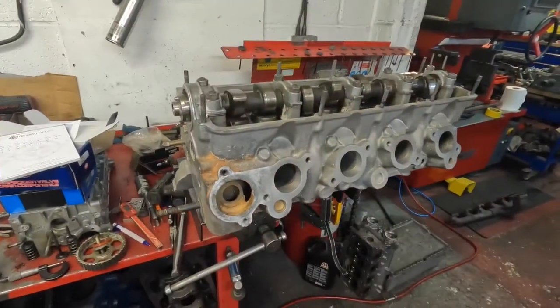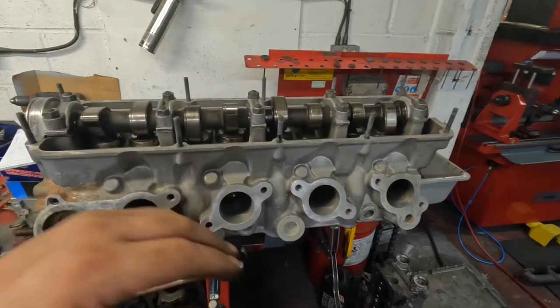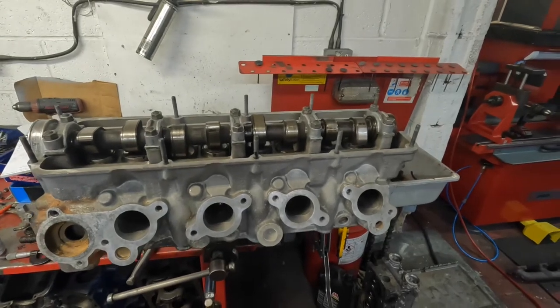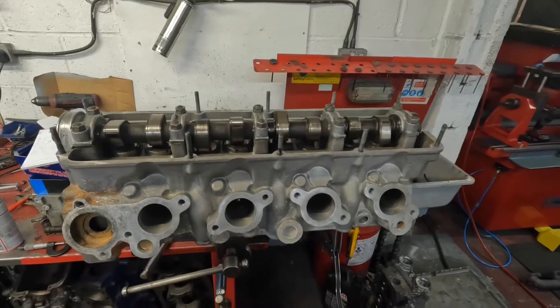So that's the AQ140 Volvo Penta cylinder head complete. I've just gone through the tappets, as you've seen on time lapse. Two of them were okay, but the others I've had to put shims in. I think I was able to jiggle two of the shims about, but the rest have needed new shims.